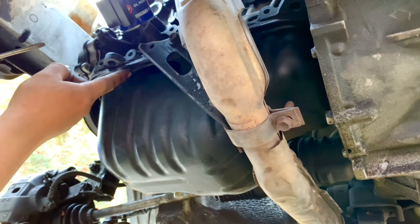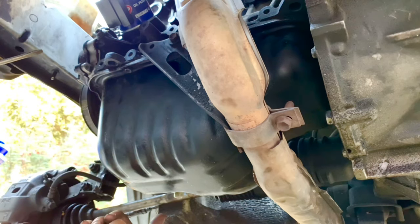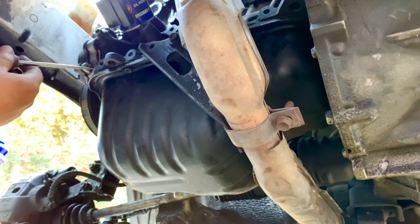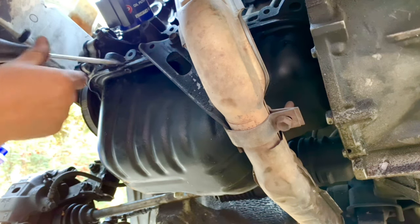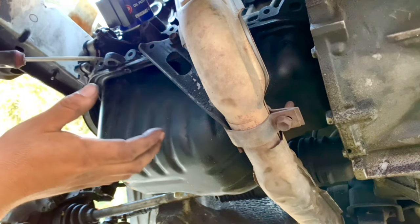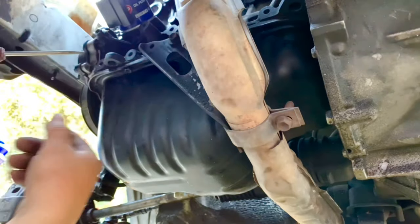What I've done is left the front outer bolt on and the one in the back just a couple threads in. I'm going to use a screwdriver to slowly split it from the block, so that those two bolts control the weight of it while I split it all the way around.